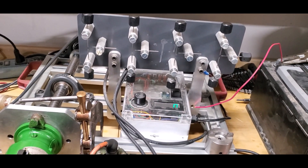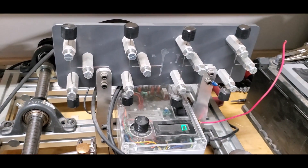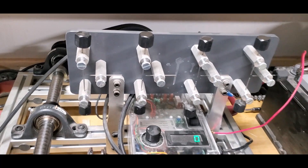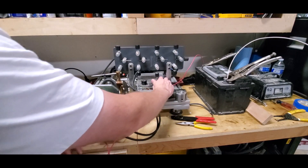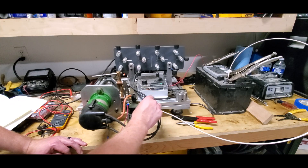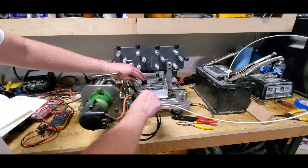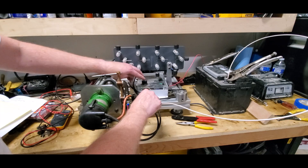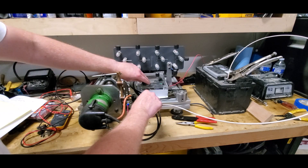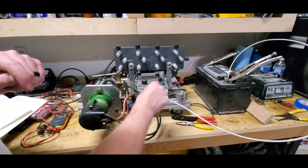I'm going to turn on the tester and then go ahead and turn on the ignition by touching this here. There you go. With the distributor, you can turn the speed down nice and low. Works great — you should be able to hear a good clean snap from that blue spark when it jumps across the gap. That gap on this tester is about three-eighths of an inch.